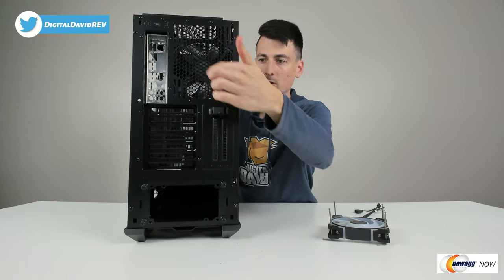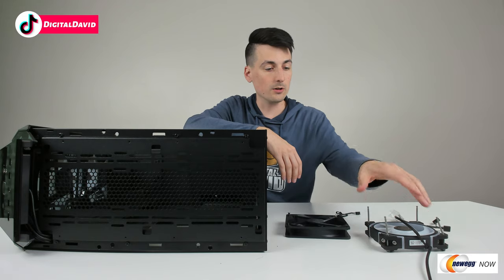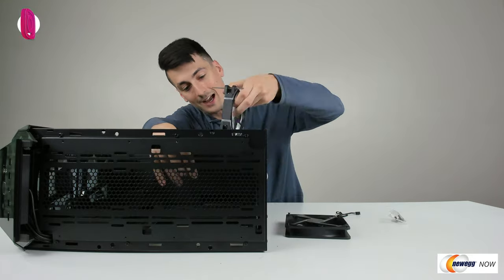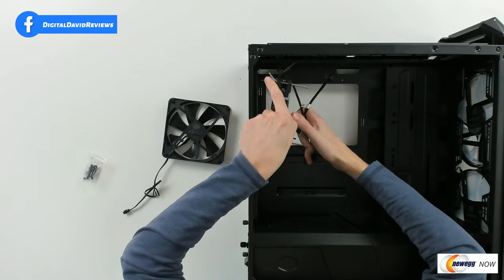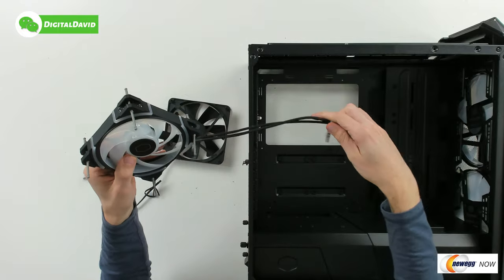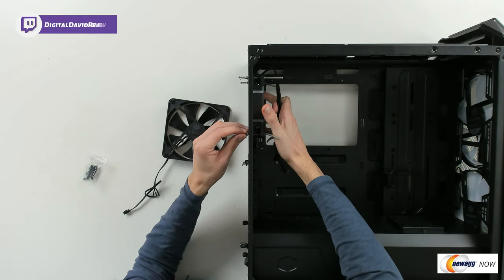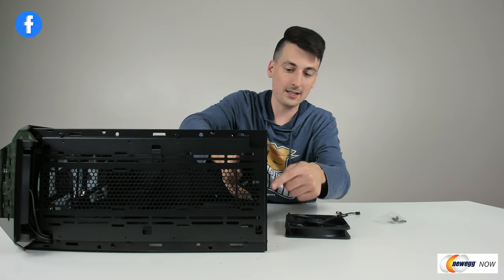What we need to do is take these four screws out and remove the fan. So you can see I got the old fan removed right here. And we have the new fan ready to go to be installed with our four included screws. At this step, make sure you choose the correct setting you want on the back — you can flip that switch and also choose how you want to have the cables run. I think in this case I'm going to route those cables to the side, right around the I/O cover and out, so we can tuck them behind and then connect everything behind the motherboard. So we'll just go ahead and make sure everything's lined up how we want it. Now that we have it fitted where we want, we can slide it back and forth to really get the final position and take the new four included screws and tighten everything in place.